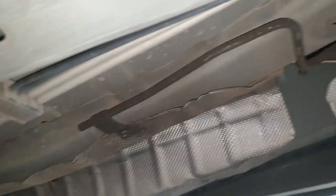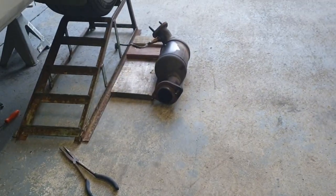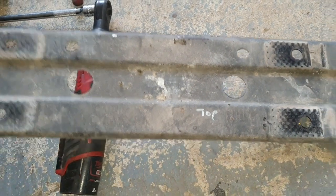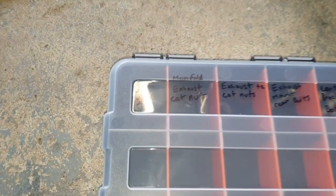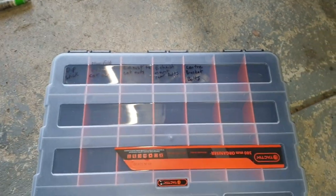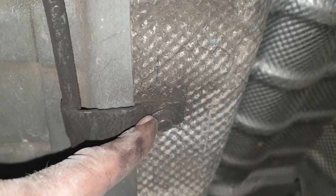With the exhaust out of the way you've got a lot more clearance to get into that drive shaft. A little tip: when you take the catalytic converter off the driver's side, put it on the driver's side; same with the passenger's side. If you take any brackets off, draw an arrow so you know it goes top-forward. Buy yourself a cheap container — they're about 8 bucks from Bunnings — and label every nut and bolt you take out. Technically the way you've taken it apart, you do a reverse procedure to go back. Now you've got the heat shroud to remove; it's only held up by two 10mm bolts, one on each side.